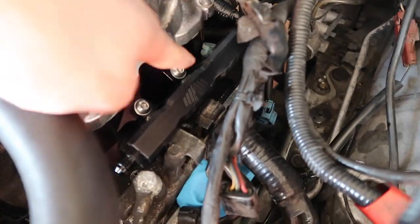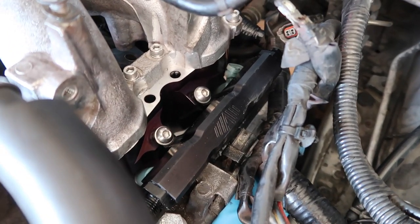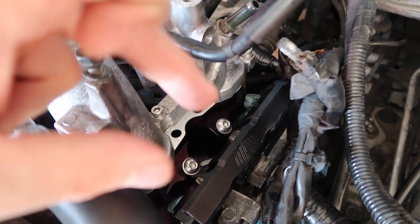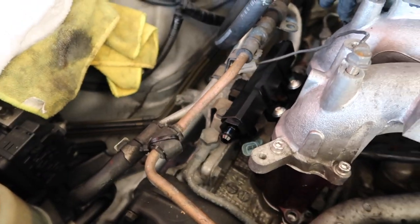So anyway, as you guys can see down there, the Aluminati fuel rails are on the Aluminati TGV deletes and the STI fuel injectors. I just have to shave the ears down, and then I can plug them into my factory harness. Because the ears, the little tabs on the side, are a little bit different from the side feeds, but no big deal. So again, I'm just going to sand those down, make them smooth, connect the injectors, and then we're making really awesome progress, and then I can run the fuel lines that Ryan made me from 1320.